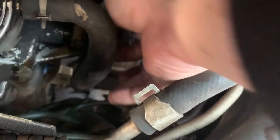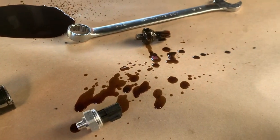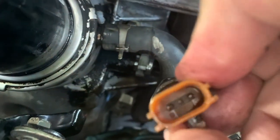There's not a lot of room in here — two-wheel drives have a lot more room. Get it finger-loose from the back end. Here's the old one and here's the new one. Try not to get oil in the electrical connector. This new one doesn't seat flush — it's a slightly different design. I did have an oil leak up here that I fixed previously, and some oil got into the connector and ruined it, so I cleaned out the electrical connector and reinstalled it.